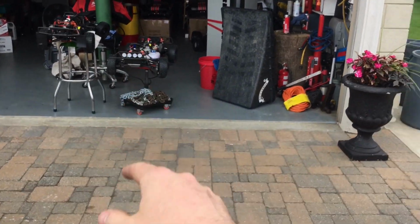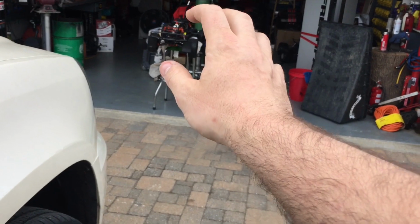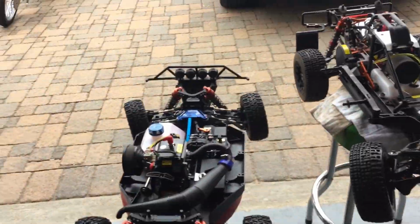It's going to sound nice, but do not be tempted to rev your motor. That's the first time ever it's running. Do not be giving it gas. Let her warm up. Let her run. Let her heat cycle. Okay, I gotta move on.